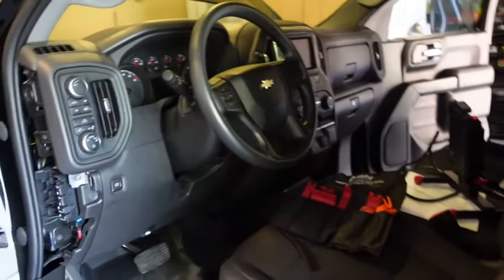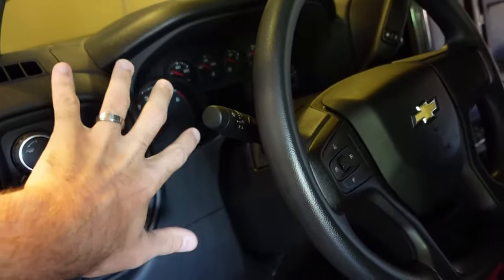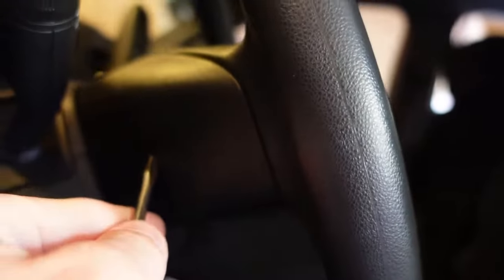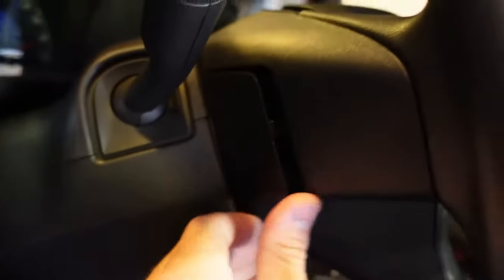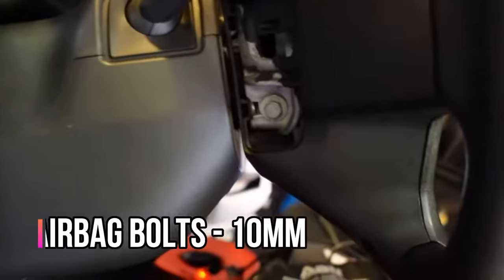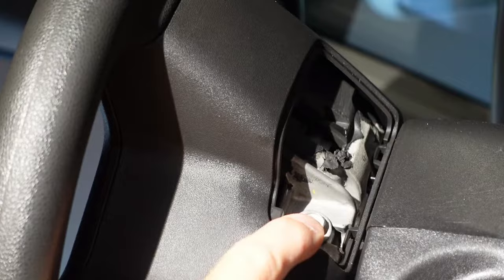I've done that — it's been sitting for over an hour. I'm going to start removing the steering wheel. I did remove a panel on the side because we'll need to get at some stuff for the dash cluster, but we're going to concentrate on the steering wheel first. On the back side of these steering wheels there's a little panel — you can just take a little flathead screwdriver and those panels come right off. On both sides there are 10mm bolts, so you just take those bolts out.